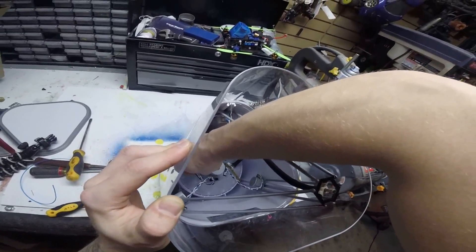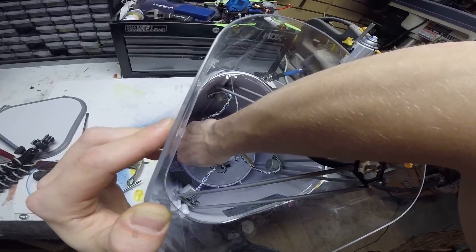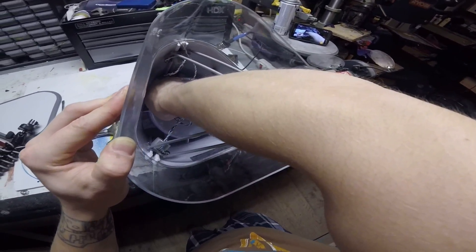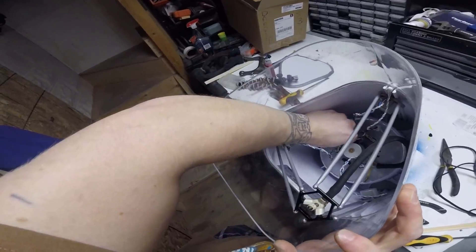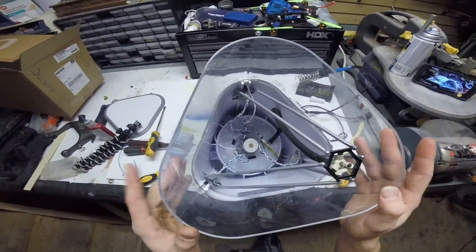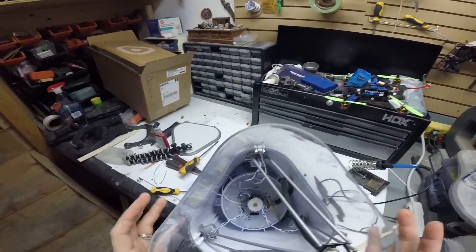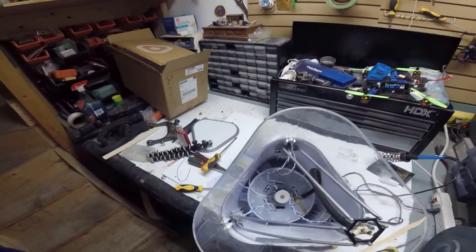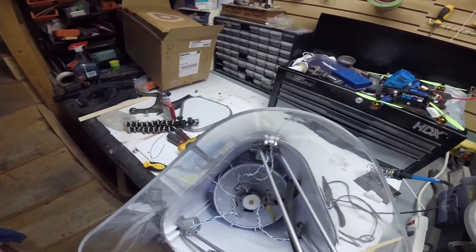Now I've got to get the tube back on there — this one was giving me trouble last time. Everything is so compact on this that I have a hard time reaching in there. That was simple — locked right in. Now let's go see if that will work. Just a side note: remember how you plugged everything in — it's super important or you're going to screw something up. Keep in mind the two prongs on the four-wire plug should be facing the motor. That goes for all of them all the way around. The other ones only lock in one way.